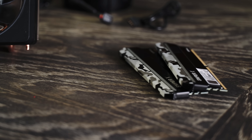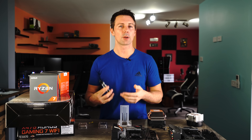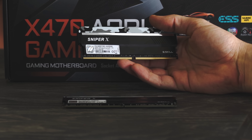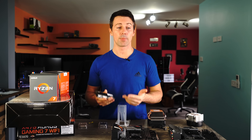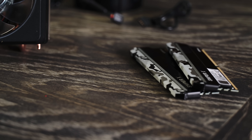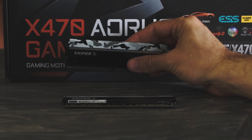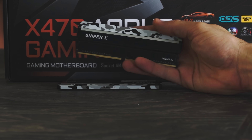The last thing to talk about with the Ryzen 2nd-generation chips is memory. Memory manufacturers have put together more compatible modules for these motherboards this time around, so you won't have as many problems overclocking your memory as a lot of people did on the X370, especially around launch. This kit here is 3400 MHz XMP — that's what you're guaranteed with these motherboards, though I look forward to overclocking it even higher. Ryzen is very memory-dependent and loves high memory speeds, so this stuff is definitely going to be certified since AMD is sending it out with reviewer kits.